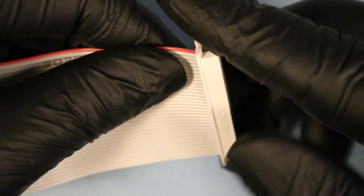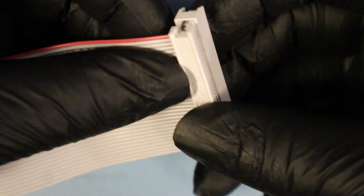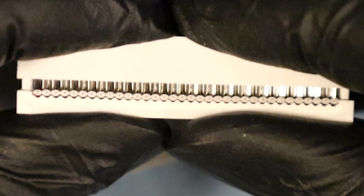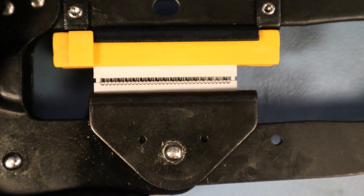After verifying that my cable conforms to the conventions, I insert the cable in the plug, making sure everything lines up. You can see there are some small grooves in the plug — I'm making sure that the cable fits into those and I give it a little bit of pressure. Holding it with my hands, I slide it into the plier, still applying a bit of pressure, and now I give it a good squeeze.